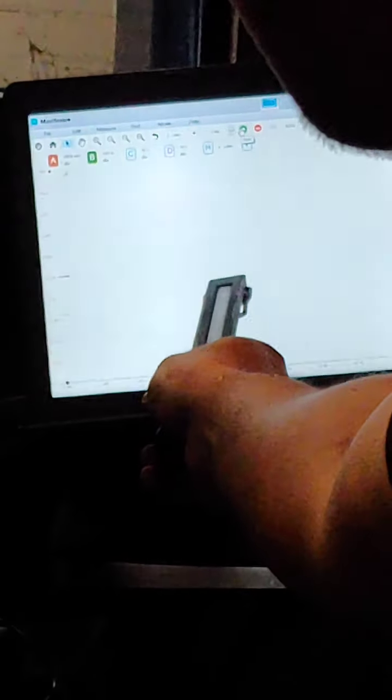Right now, as you can see there, there's a good looking waveform. This is on, off. And as our voltage turns on, that's our lock position. When we unlock, it just reverses the polarity to unlock it. But our amp probe is the same, right?